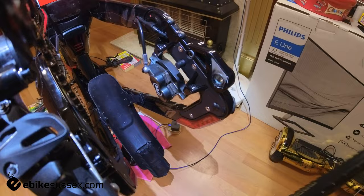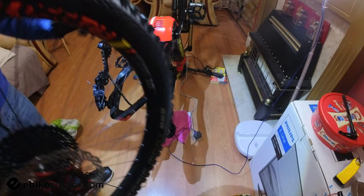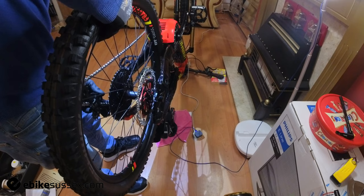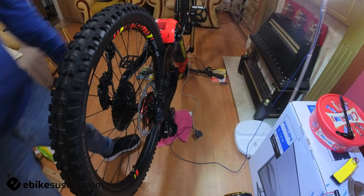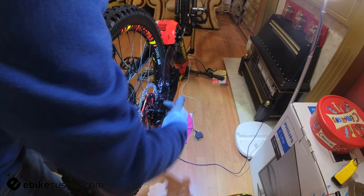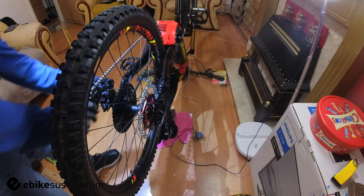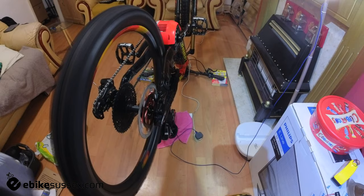That's how it was done through that process. Sadly there was no full video while I was doing it. Let me put the wheel back on and in place. The wheel slides in nicely. Let's put the shaft back in place and tighten to 11 Newton meters — not over-tightening. Let's release the derailleur, give it a nice spin — happy days!